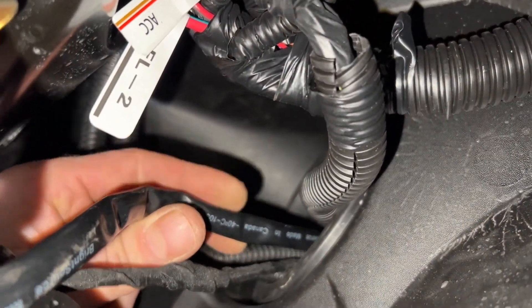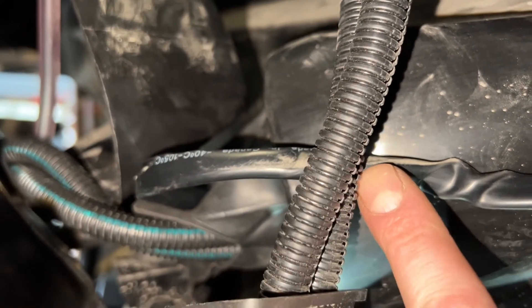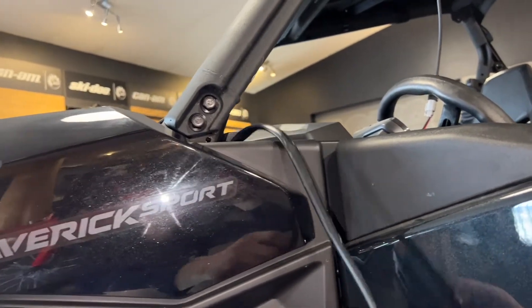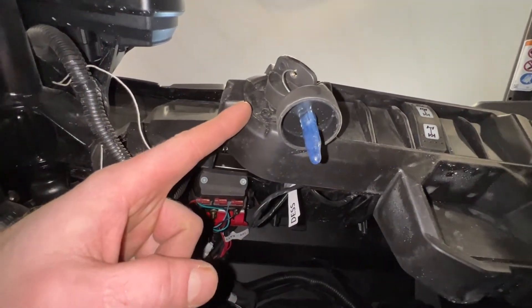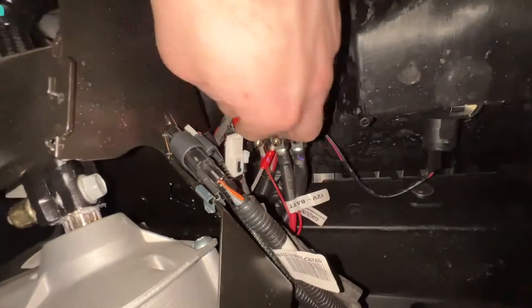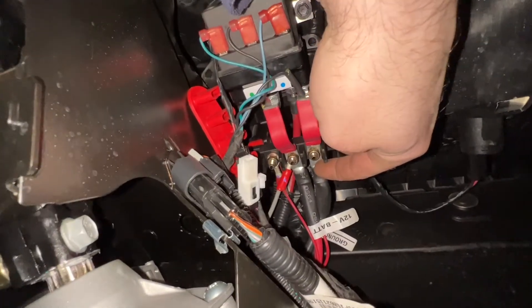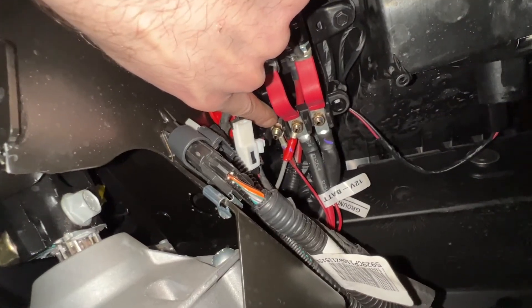I've had the power wires going to the light bar from the inside, through the hole in the firewall, through the rubber boot, and then we come out here, go around the other wires, follow the frame up and out the hole in the top. The next thing we need to do is connect the harness to power. As you can see the key is right here — right underneath the key is the power bar. This is the negative terminal, this is a hot power terminal, and the third one over is a keyed power. We're going to connect it to the keyed power.